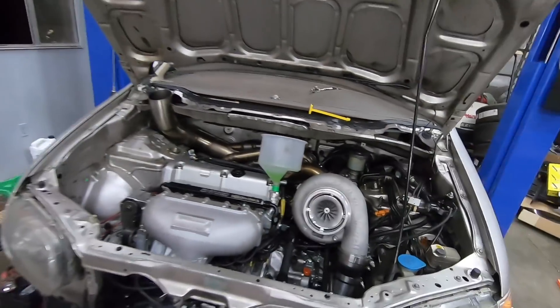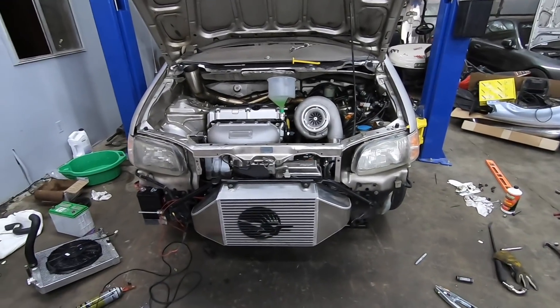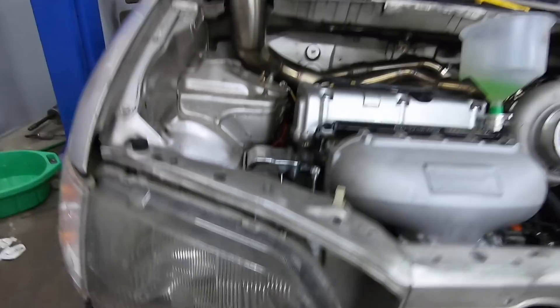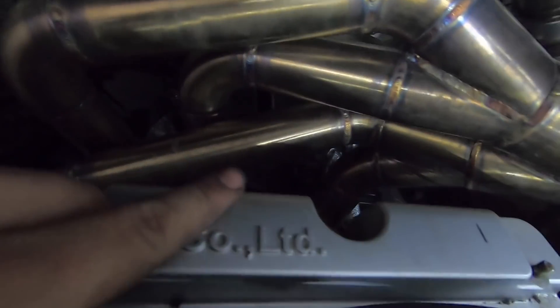Radicee's back up and running — she sounds awesome. We have good oil pressure. I shut the camera off for a while and let it warm up for quite some time to double check it wasn't getting too hot. I let it fully warm up and she's good. I ghetto-rigged the fan so I could touch the positive to the power, because I have the fan set to come on at 170 degrees. It got to about 172, I plugged the fan in, and it came down to about 165 before I shut it off — so it was actually cooling it down, which is really good news. I can't confirm how it'll do when we actually drive it. I also mentioned we needed to put little heat covers over the rear heater lines because they were really close to the manifold — we did put little heat shields over that, just sleeves from the parts store cut to length.